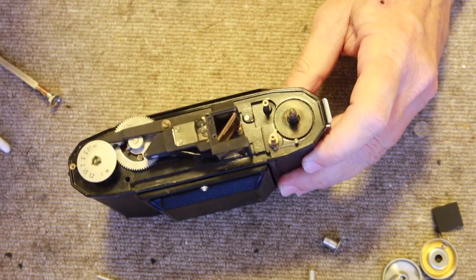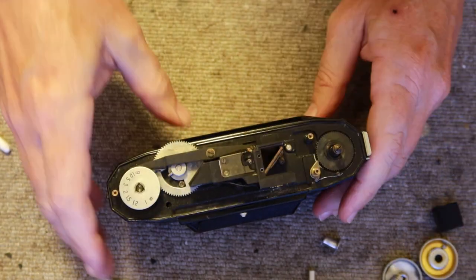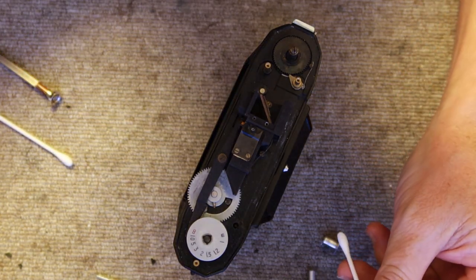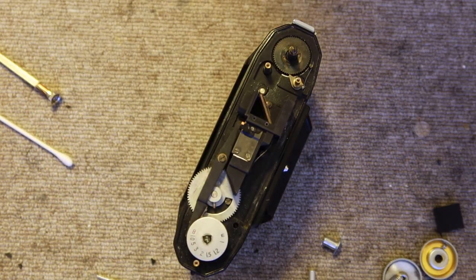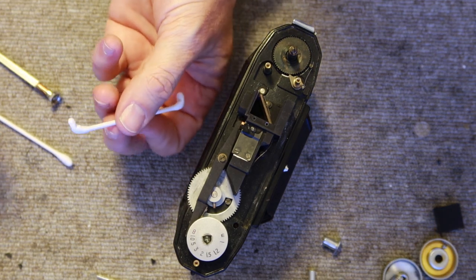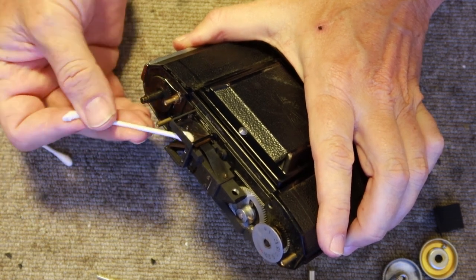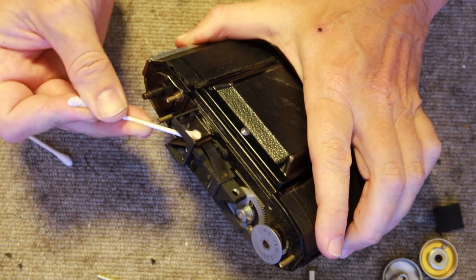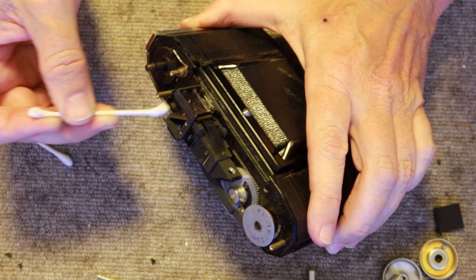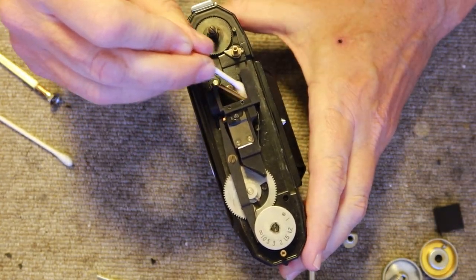There's some dust inside. You can use a rubber blower or just blow out the excess dust. Take a cotton swab — one thing that helps is to bend over the tip of the cotton swab, which I do simply with a pair of ordinary pliers. This allows me to reach around corners to clean the back side of the glass. Sometimes the front window will pop out as easily as the back one, which is useful when repairing but not ideal when trying to use the camera.